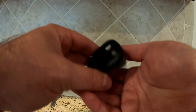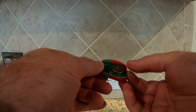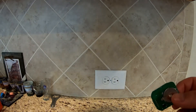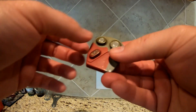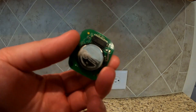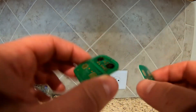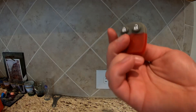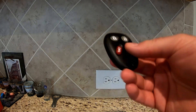I split the case apart on one of the new replacements and had no idea it had a circuit board behind it — very interesting. What I'm going to do is not use the new circuit board; I'm simply going to use the new rubber pad and plastic outer container. Here's the worn-out rubber buttons from the OEM GM fob versus the newer circuit board just for comparison. So we have the old circuit board with the old battery and the new buttons — and there you go, we have a brand new key fob shell for the truck.